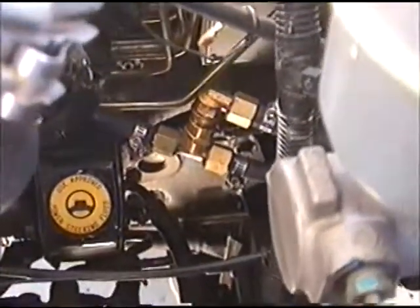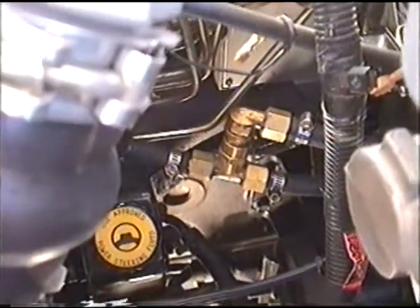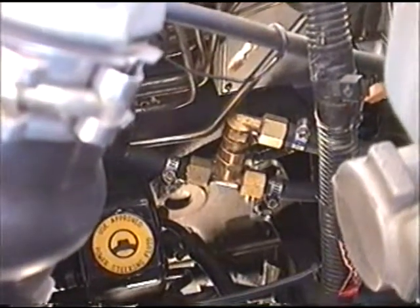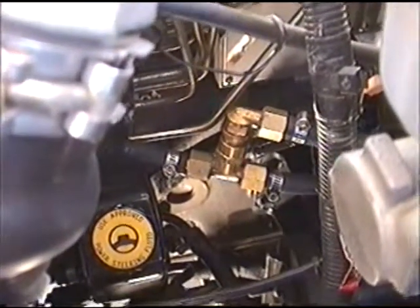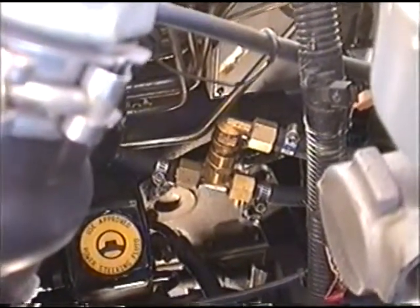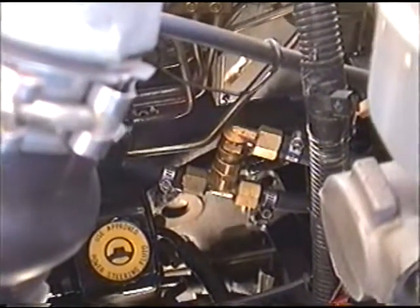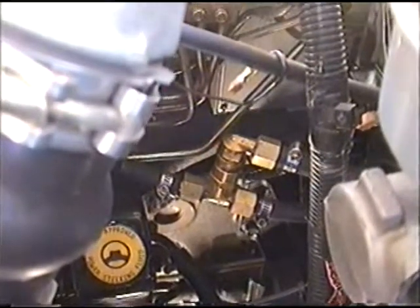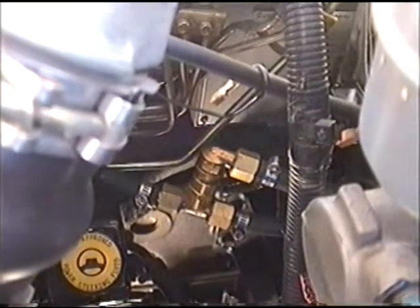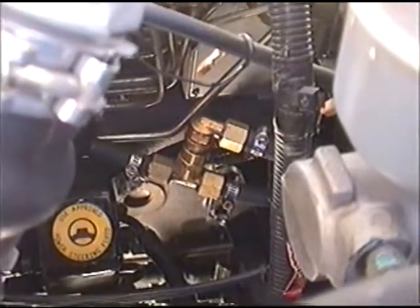And over in here you can see the bypass valve and fuel return line that regulates the fuel pressure going into the VP44 because of the Walbro high pressure, high volume fuel pump. And this limits the fuel pressure to about 15-16 psi at idle, drops down a pound or two under heavy load, and generally works pretty good, can't complain. So we'll go inside and see how all of this works.